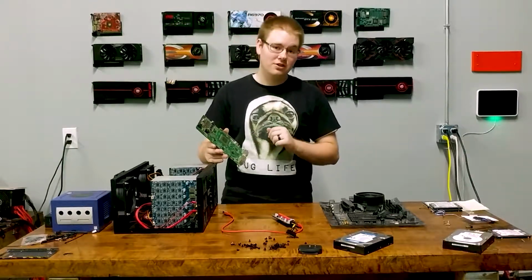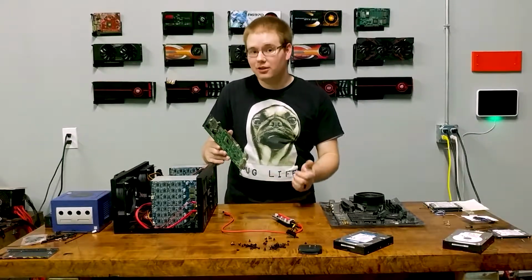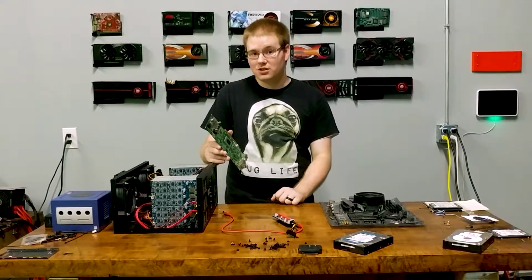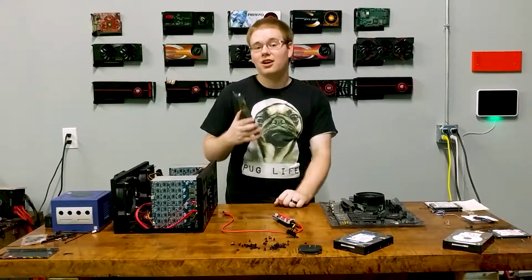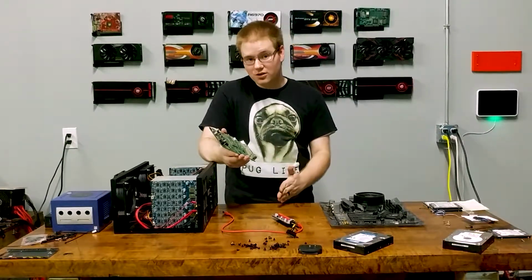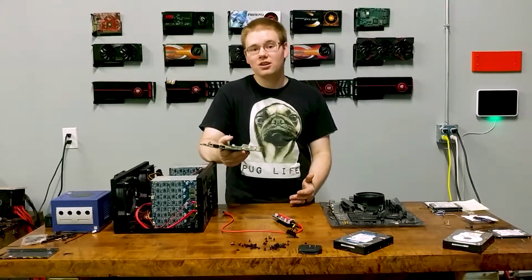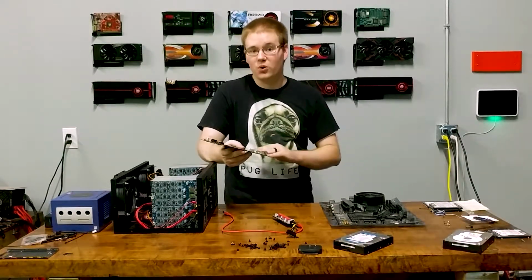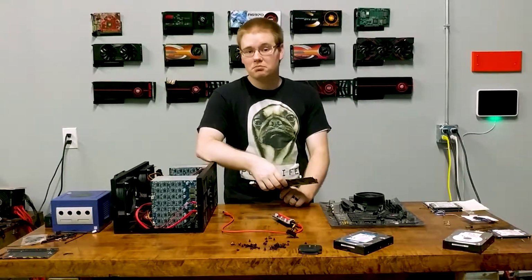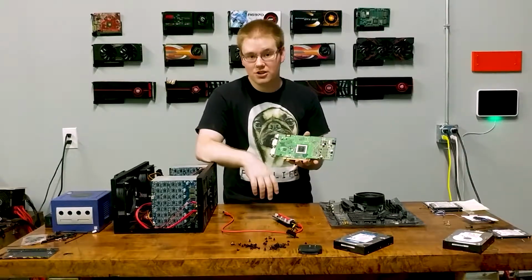Now how about the other two? Some cryptocurrency algorithms, such as Ethereum and Monero, do reward you if you undervolt your card. I'm mining Monero on a few RX Vega rigs, and the stock voltage for RX Vega is 1.2 volts. I have my cards set to 1.0 volts. So that right there is a pretty nice reduction in voltage wear on the GPU.